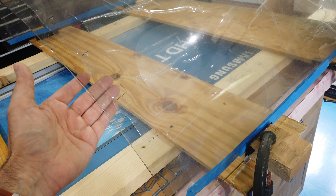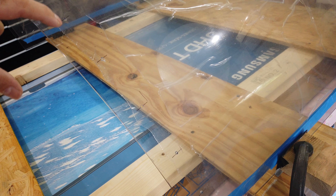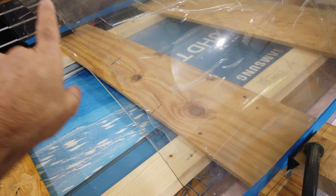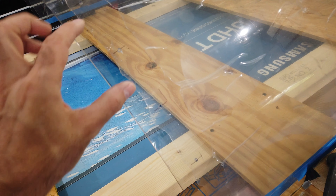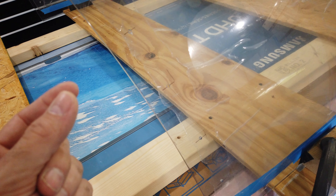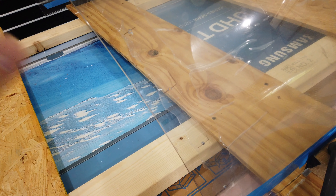On the canopy frame you can hopefully see where it left a little mark at each hole location. Next I'm going to deburr these holes. My plan is to put an aluminum strip between - the aluminum strip will be attached to the canopy and then it will span across the seam between the fixed rear window and the canopy. Normally you would countersink these holes for a number six screw head, but I'm going to countersink these holes for a dimple.